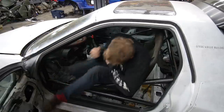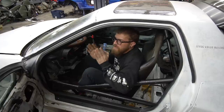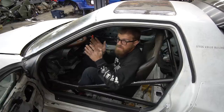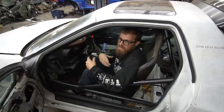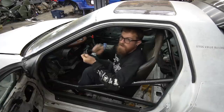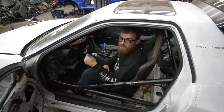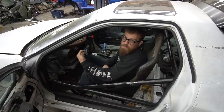Without power steering, I couldn't really get the wheels to turn any further than I could get them to turn without the car moving. When you do angle mods, you're essentially quickening the steering ratio because you have the same steering ratio — say it's two turns lock to lock — except now the wheels turn twice as far each direction. So you're effectively quickening it by 100%. The steering gets a lot heavier because you have way less mechanical advantage over the wheel. We definitely need to get power steering on this car — we're going to try the electric Volvo pump or I have the normal GM pump off my LS Miata.